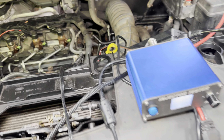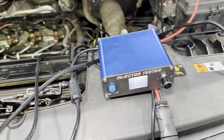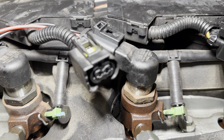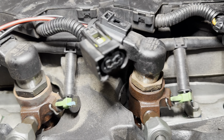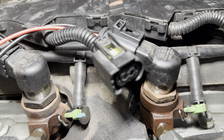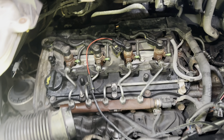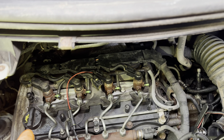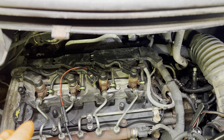We've got this little gadget from eBay. If we press that button we can hear the injectors click — you can hear that injector click. So that means there's electrical integrity, but we already knew that because we put our scope on these injectors to see if we had a pattern.